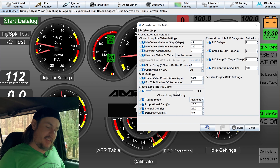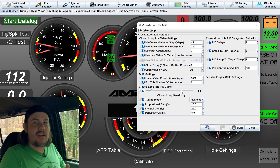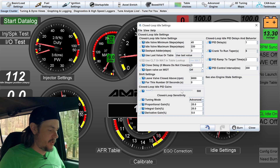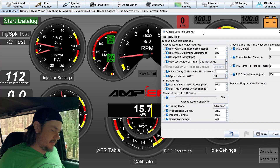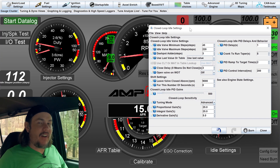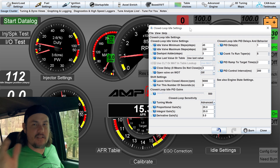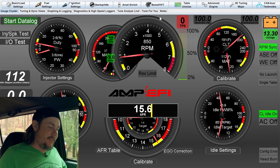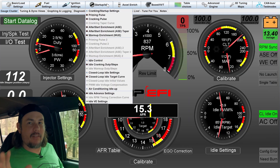The other big thing to look at is the closed loop PID gains. This number determines how much change it can make per adjustment when trying to correct. Right now it's pretty slow and our idle is right on target at 850, so I'm leaving it at 500. But if the idle starts oscillating and overreacting, you can come in here, lower down the PID gain, and that will help with that.